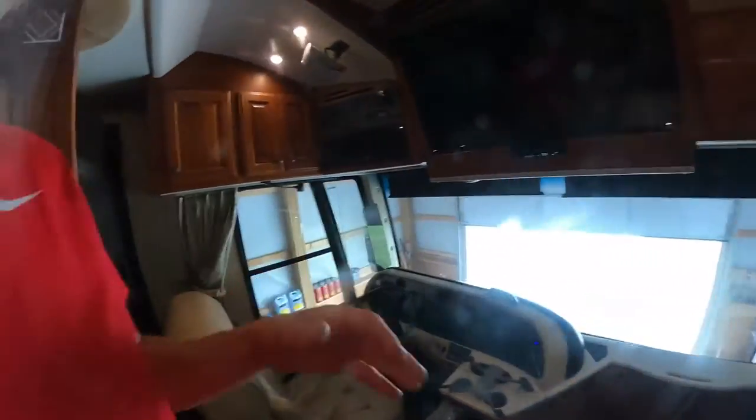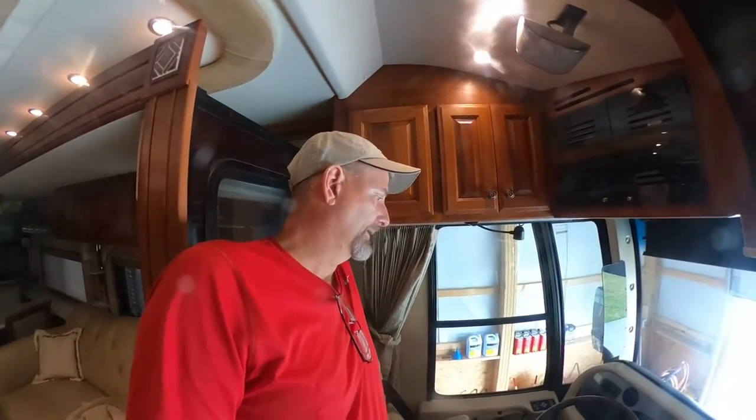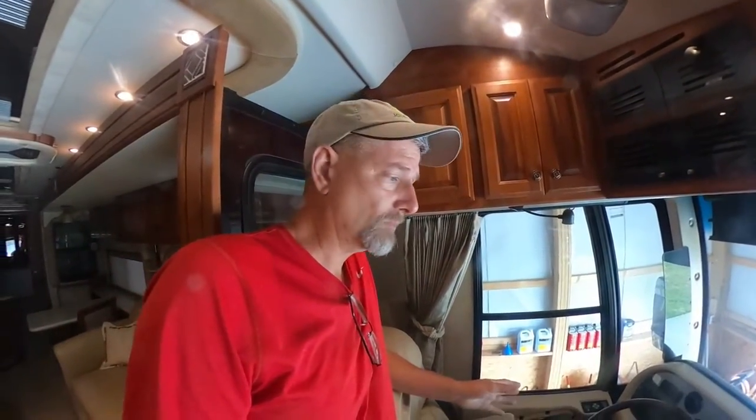So yeah, right now I'm just chilling the unit down. We're about an hour out from leaving. I still don't have dash AC. I replaced the motor, the relays, the modulator. I cleaned the van. I mean, it was just nasty, so I cleaned it all. It had never been cleaned. I don't even think air could have been flowing through there anyway. But anyway, got all that done.